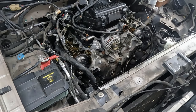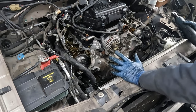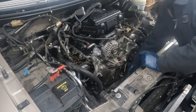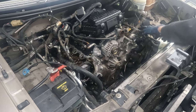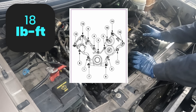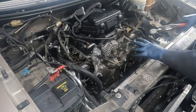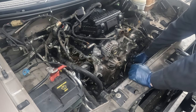Take our cover and put it in at an angle, then set it in. Put just a couple bolts in and snug them. Let our RTV set up for however long your RTV says to, then come back and torque it up. Put in our oil pan bolts - not tight, just threaded in. Once those are started, torque our bolts - I'll throw the sequence on screen. They're all 18 foot-pounds, then go back and torque your two bottom bolts to 35 foot-pounds.